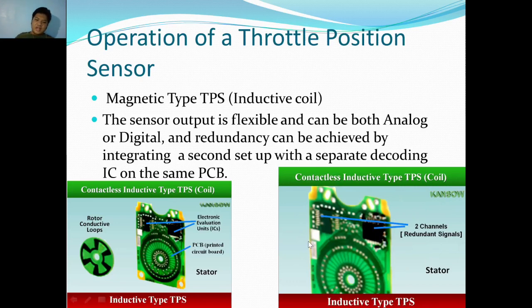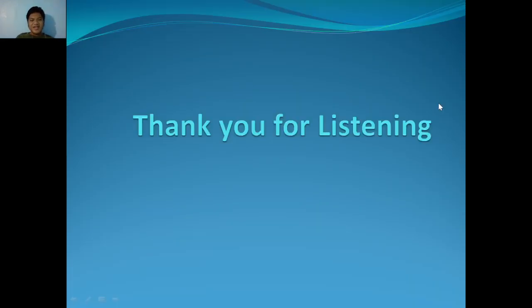So again, unlike in the Hall effect, which can be run by one electronic evaluation control unit, in an inductive coil you need two, so that it can evaluate what type of signal it wants. It can be analog or digital. There you go. You can see it. And by the way, the reading of it is the same as the Hall effect type. So I haven't shown a graph of it. Thank you for listening.